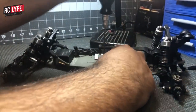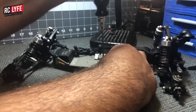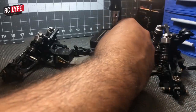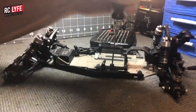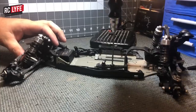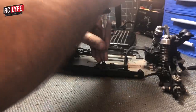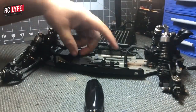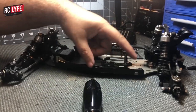Keep pushing down to make sure everything gets tightened down. Tighten until snug, then back off one or two turns. Do the same on the other side — back it off one or two turns so it's loose and can move back and forth. If you're going all the way forward, turn the mount the other way; the angled part will follow the contour of the chassis. We run it backwards for a dirt setup so it doesn't interfere with the body.